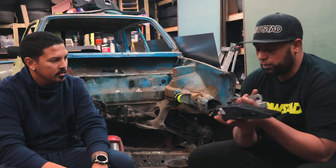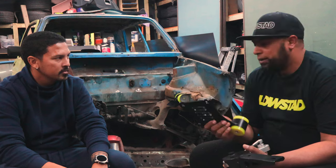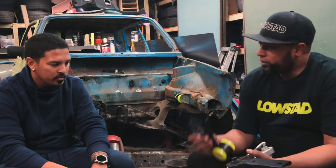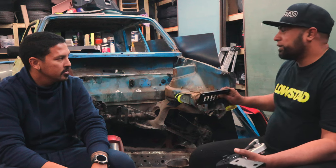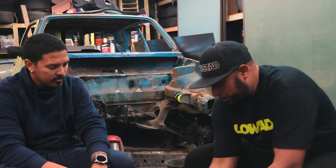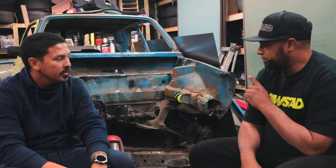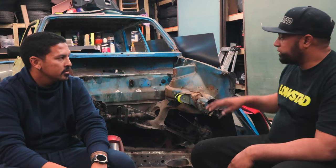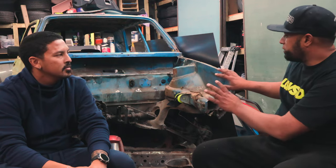This is the front one for the gearbox. There's another two, one would be another gearbox mount, I think, and an engine mount. This bolts directly onto the motor, and we just attach it to our existing mounting points. So it's that easy. Well, I think it's that easy. So we're going to do a motor swap. We're going to flush the whole engine bay out and clean out everything, and then that would be the front.